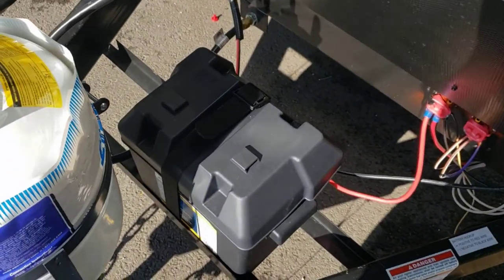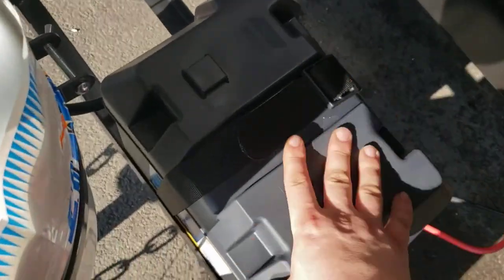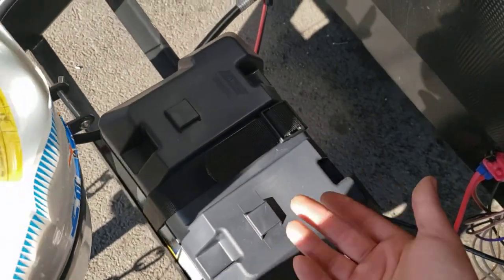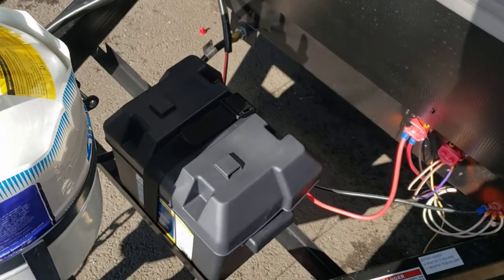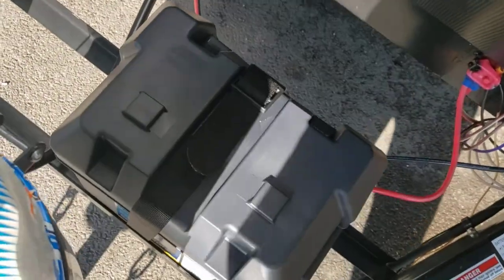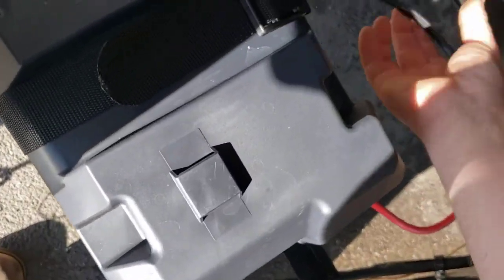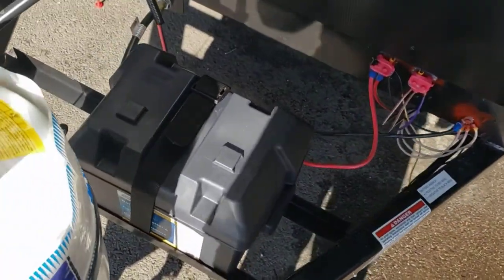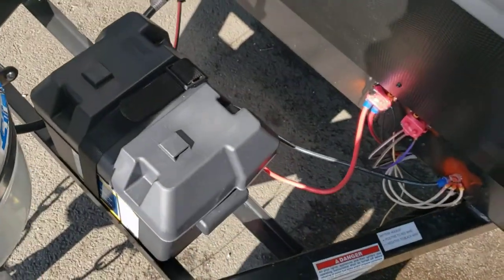Group 24 RV marine grade battery — brand new, so you don't have to worry about getting one installed. In winter, I recommend taking the battery completely out and storing it somewhere warmer than just sitting outside in a cold garage. When you're using it, between trips I recommend disconnecting the negative lead off your battery. That's going to keep anything from draining your battery while you're not at the camper.